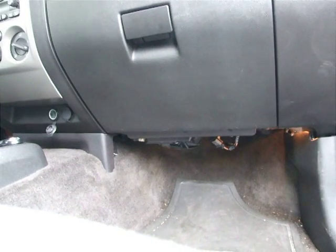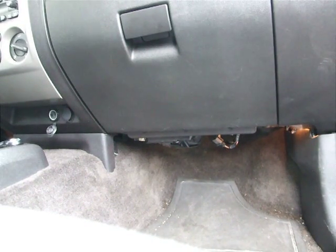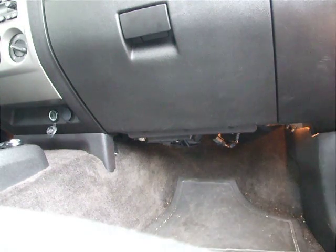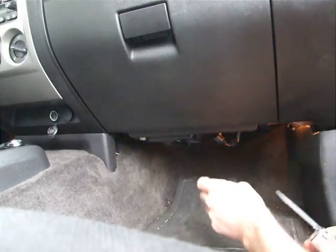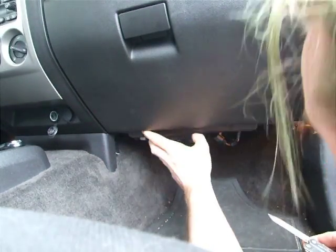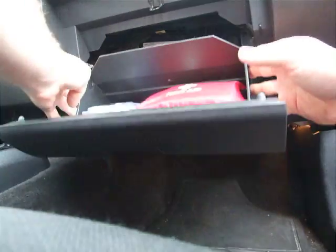To start, I'm going to have to make a little more room for myself to get under there to replace that whole cable. Pull that cover off. The glove box is also going to have to come off. I'm going to pause the video here for a second. It's these 3 screws, and then you just squeeze it together at these tabs up here and it'll come out.